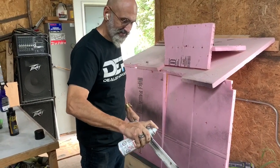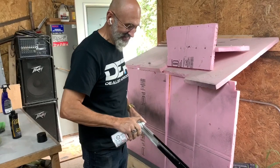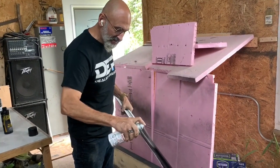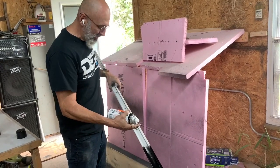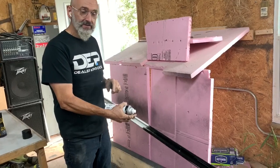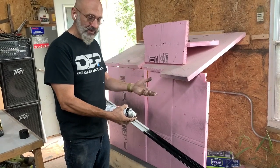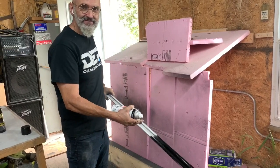Okay. What are you doing? I'm painting these. Earlier today, you sanded all of these to make sure that we had no loose paint and everything. These go behind the black moldings that go down the side of the bus. There's quite a number of these, and the reason we're putting black paint on them, should the molding ever retreat, we'll just see black, we won't see a big white mark on the side of the bus.